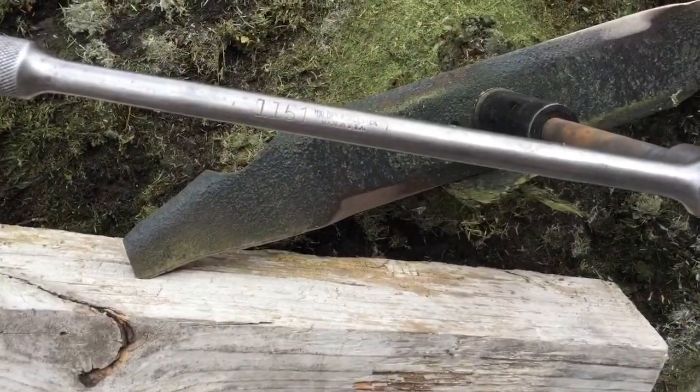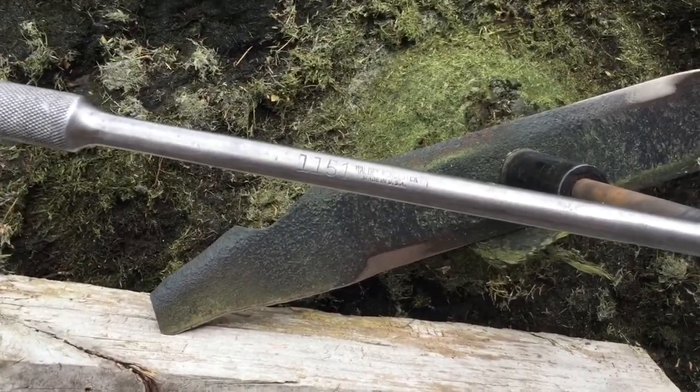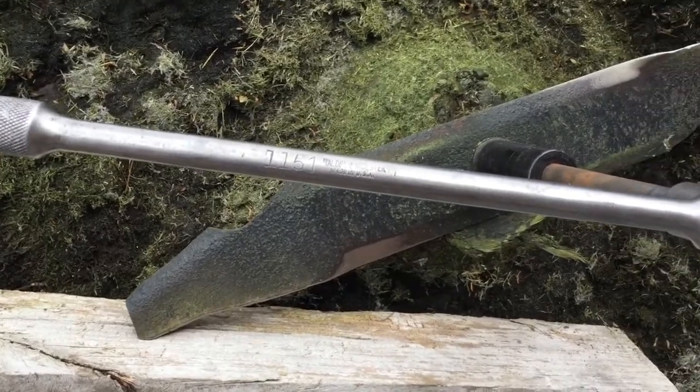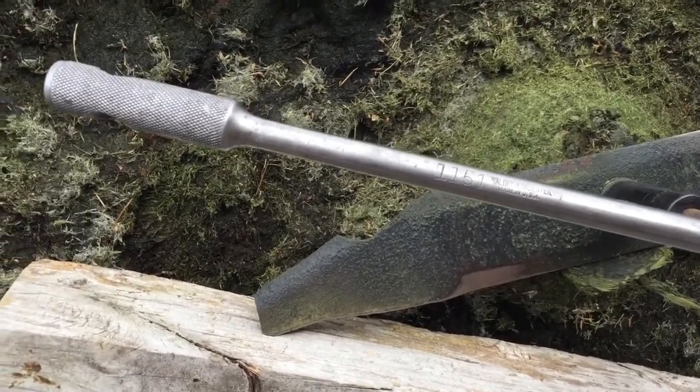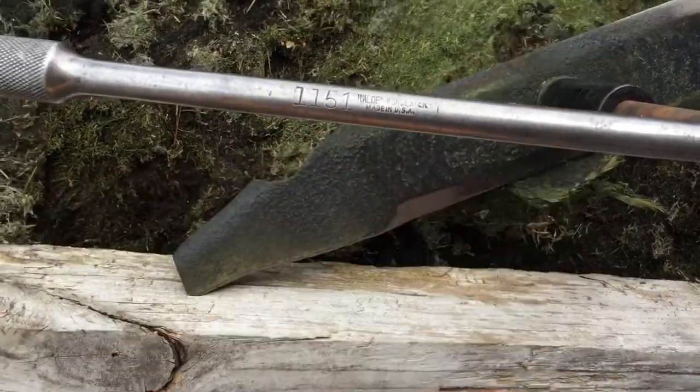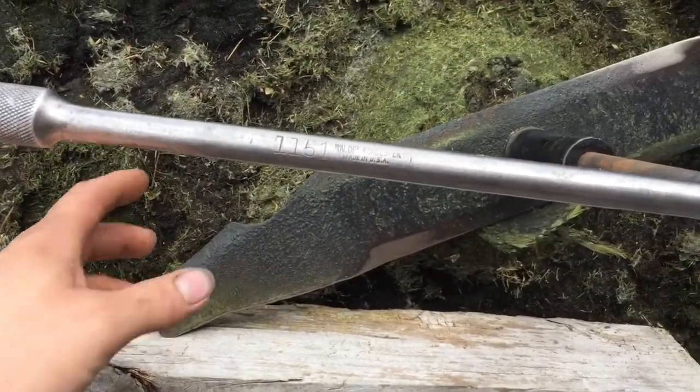Alright, so what I did here is I propped the deck up against the wheel so I don't damage it, so I can get access to the underneath. The best way to really get the blades off is if you have an air impact. It works a lot quicker than a breaker bar to get the nut off. Sometimes you don't even have to prop the blade.